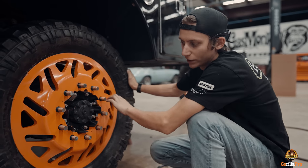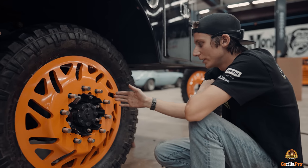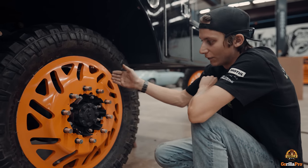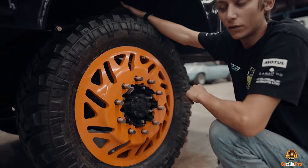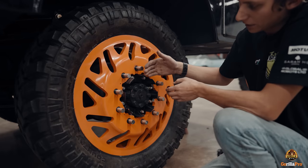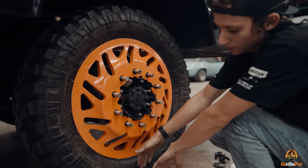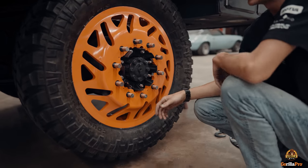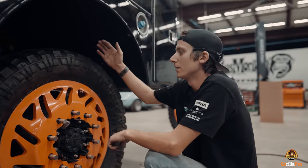So I kind of want to just explain to you what's going on back here, because there's a whole lot of madness for these wheels. We put a 2-inch spacer in the rear and behind it, then we put the wheel adapter because we need the 2 inches to make sure we don't rub on the coilover, and then we put the adapter, and then we put a wheel, and then we put another spacer so we don't create hot spots on these tires, and then we put the other wheel on, and that also gives us our width